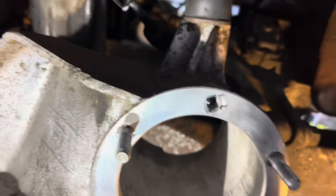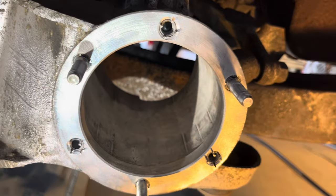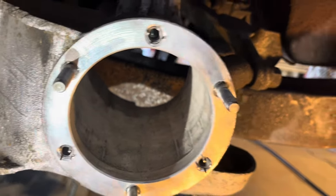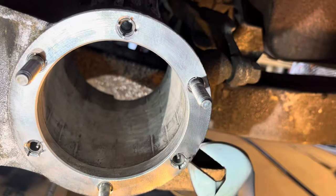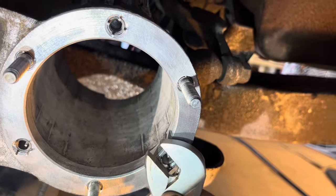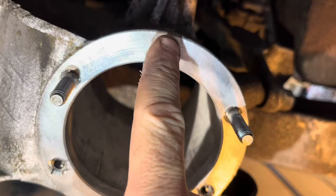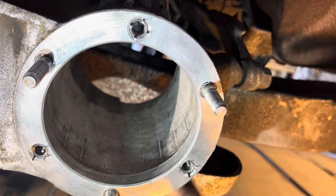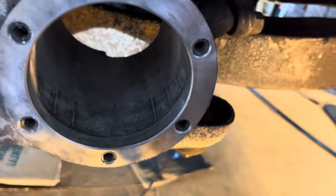The hard part was cycling through different inserts until they went in almost on their own. I ended up moving a couple with my wrench as long as I didn't feel resistance. The idea is to get the bottom of the insert flush with your recess. It does not need to bottom out — you just need it set at the right depth. Wire brush again to make sure there are no burrs on the edges.